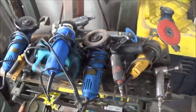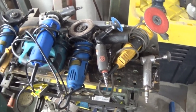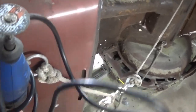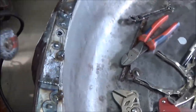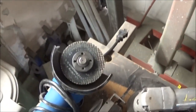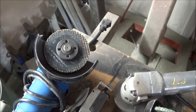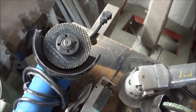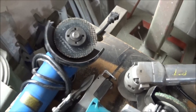We have a myriad of hand tools laid out on this small bench. What I've been primarily using for that wheel well repair is my little Dremel tool with an EZLock cutoff disc. It works really well if you're trying to follow a contour — it can follow the curve of the wheel well, whereas a traditional cutting wheel on an angle grinder gives you that big chunky straight cut that doesn't work well for that type of patch. If I'm making a straight cut and I can get access, I'll use a cutoff wheel on a traditional angle grinder.